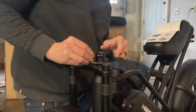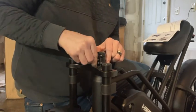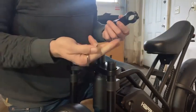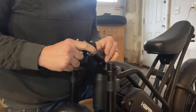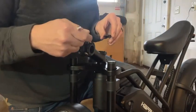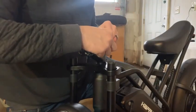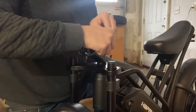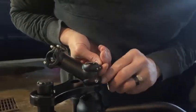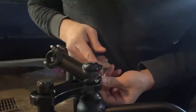On step five, you're going to use the M5 Allen wrench. You're going to undo two screws, then unscrew and remove the trim cover. Now that you remove the top cover plate, you're going to flip this around, put it back on. I have my plate, I'm going to have it so I have that Happy Run logo at the front, use the bolt, put it in, and then use an Allen wrench and tighten the top. After you get the top part, screw these back in and tighten using the M5 Allen wrench, nice and tight and secure.